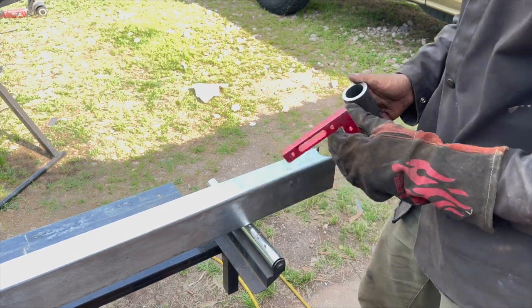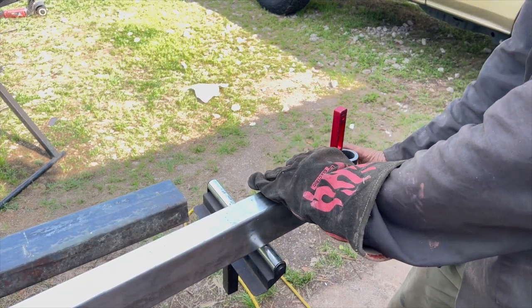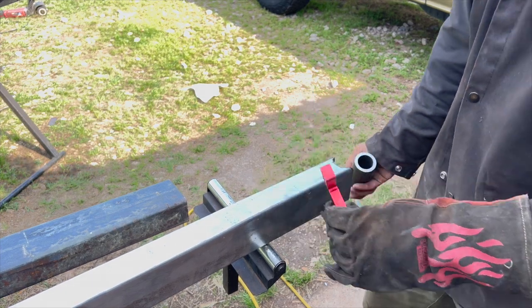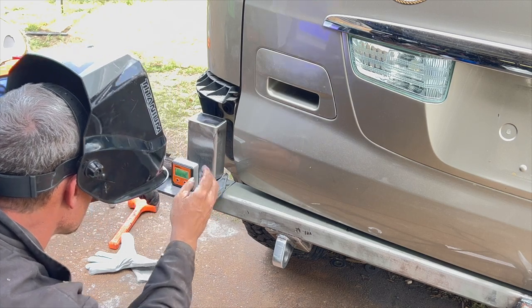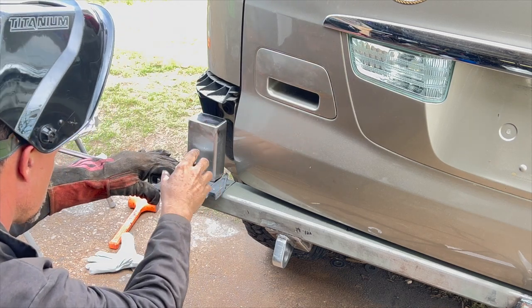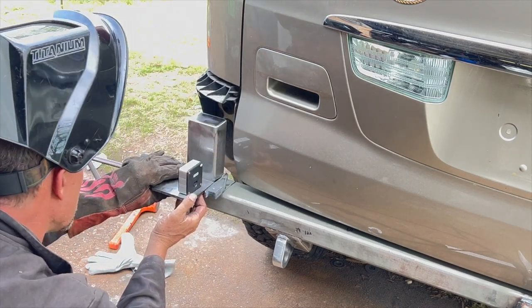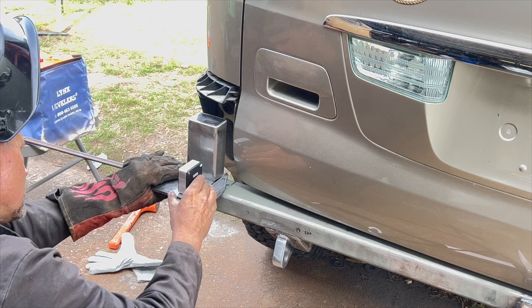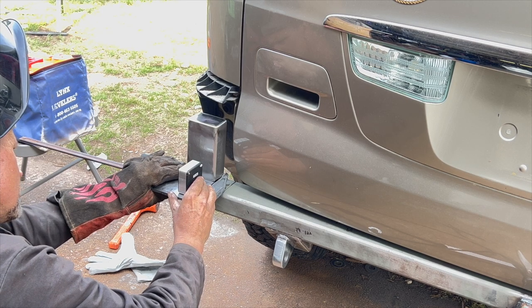It's fitting in a lot nicer into the arm. If you have another hinge cylinder you can stack it on top to get a bit more length to put up against your square — that'll help you see the position better. Once we've got the swing arm all done, we want to put it across the back of the truck. I've got these quarter-inch plates of steel cut from some steel stock, and I'm using my digital angle finder to make sure I've got it perpendicular to that tower.